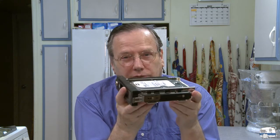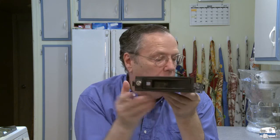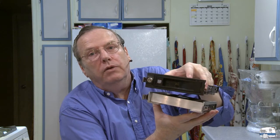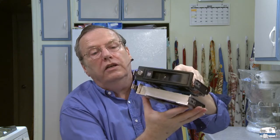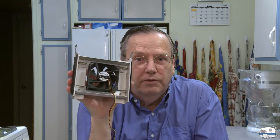The concern with this was the hard disk can get very hot while running with no fan directly cooling it. So I had one empty space down below and fabricated a solution myself — a fan that would fit in the lower case, hidden by the plastic mask, positioned below the hard disk so it would constantly blow air onto the drive to keep it cool. When you really know what you're doing with computers, you can start fabricating some of your own parts.